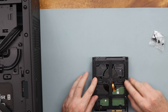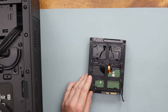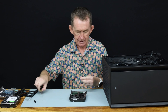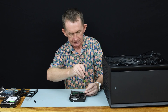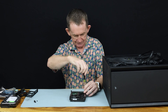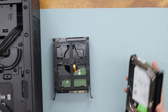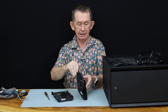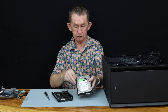Now all my screws are lined up. There are four of them here, so I'll use a small screwdriver for all eight screws. Just be careful you don't touch the electronics on the back of your hard drive when you're doing it. Then we have the second one done — and that's both of them. They slot in nicely and won't shake around inside these cases. They're really easy and quick to remove — that's the whole idea of them.